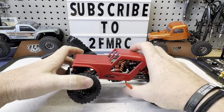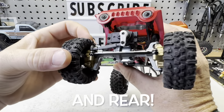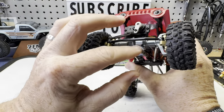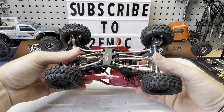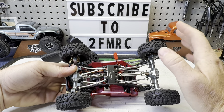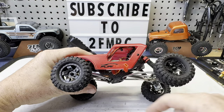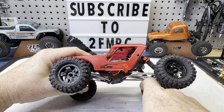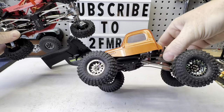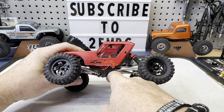You've got the aluminum axles here with the brass already on them in the front — brass inner and outer that you don't have to buy. So very nice that we've already got the brass, the aluminum axles, all metal gears inside of all of this — transmission, axles, everything — metal drive shafts. We've got a 7.5 degree angle on our skid, which is giving us this huge breakover right here, which is what we're kind of going for with custom builds. I just built that and that's what I was really trying to get — some breakover.